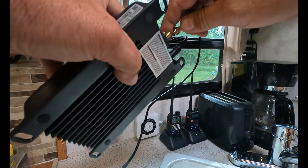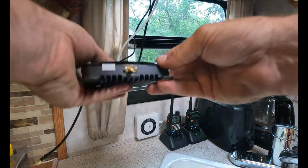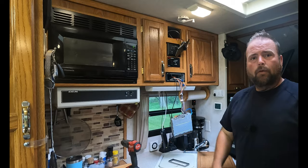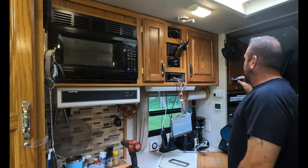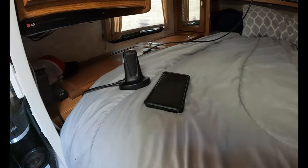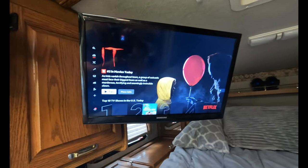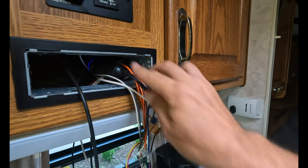Outdoor connected. Indoor connected. The wire for the internal antenna I just brought through this cupboard all the way through and dropped it down to this location. One of the reasons I picked this spot is because the cell phone has to be close to the antenna to work properly. Most of the time I'll be using this to stream data so I can watch television in here. The cell phone booster needs 12-volt power, and I picked that up right off the radio — it's already fused, so it shouldn't be a problem. Now I can start putting this all back together.